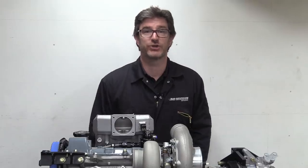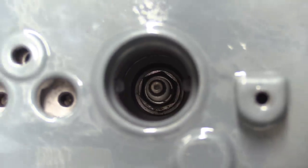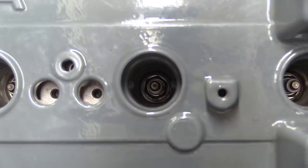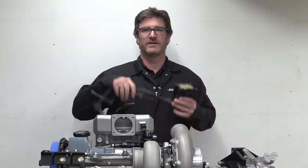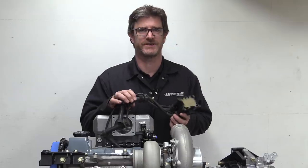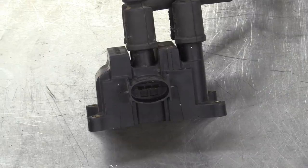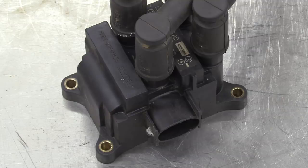As we've repurposed Toyota solution, we've got to find another way to fire the spark plugs. This wasted spark coil pack was the manufacturer's upgrade to the distributor. The DIS, or distributorless ignition system, offered many benefits over its predecessor. It was basically maintenance-free and was managed by the ECU, allowing much better control over the ignition timing. This one is a Ford system we were using on the rally car.